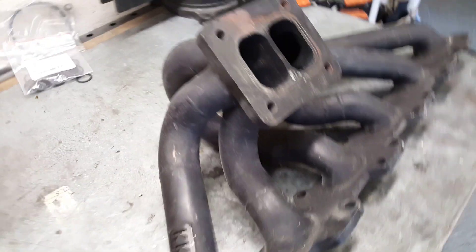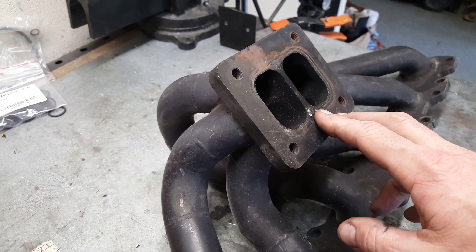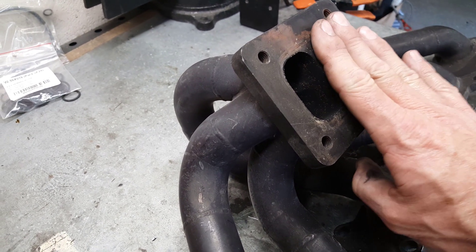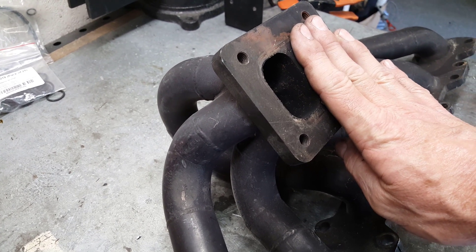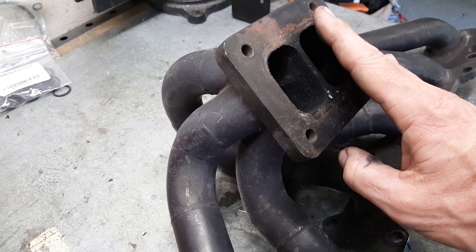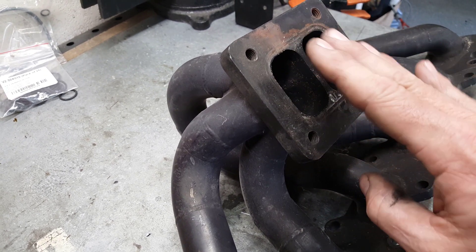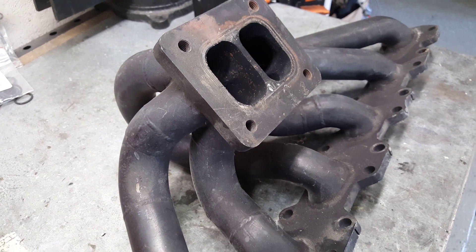Here's the KKD header. As you can see, it is truly a divided header. The reason I mention the BD Diesel diverter valve is because it is thicker and it will not block off one side of this like most diverters will. If we do that, there will be repercussions. It needs to be thick enough so that when it closes, it allows the exhaust gas to come over to the other side. Without that, we're going to have some major engine problems.